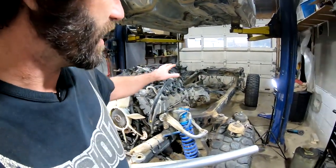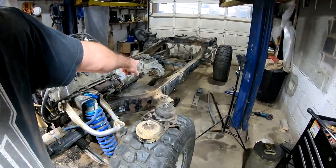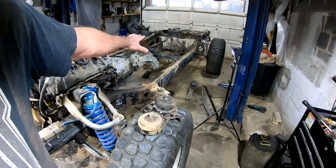In recent previous episodes, we decided to slide the entire cab back about four inches and take the engine and transmission with it. That's going to put more weight on the back tires. I want to keep all the weight as low as possible for low center of gravity, but we also want high clearance at the center of the truck, so I'm trying to keep that transfer case up out of the way.